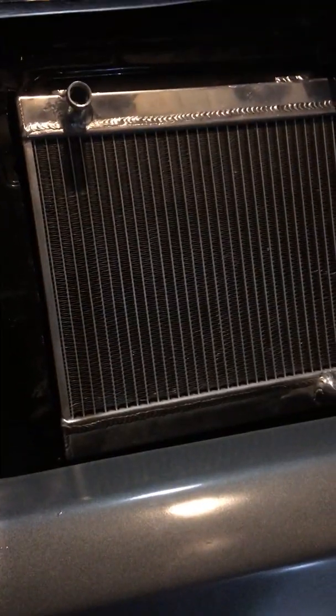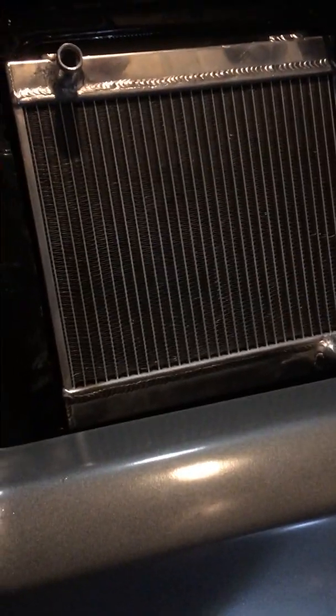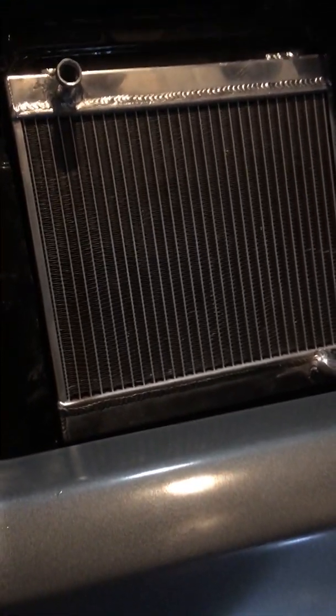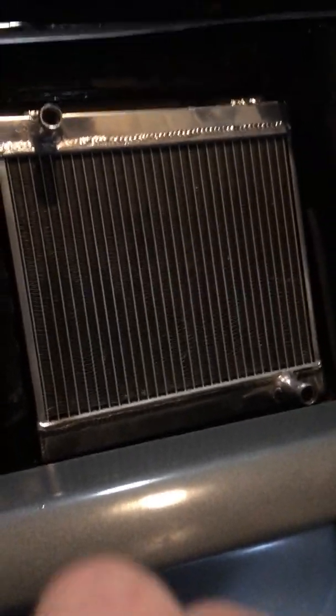One where the hot fluid goes out of the top of the ATR intercooler down to the bottom Sports Machines into the first tank. It's the upper tank. You know, the Sports Machines has a double pass, remember. So we have a bung in there. It already came with it. The Sports Machines already came with one 1/8 inch NPT for one of these type of sensors. So I don't remember if Tom's is on the top, the bung, or the bottom. I don't remember. But I added another one because on the passenger side, onto the truck, that intercooler is split in two tanks. So it goes, boom, and then boom back, double pass.